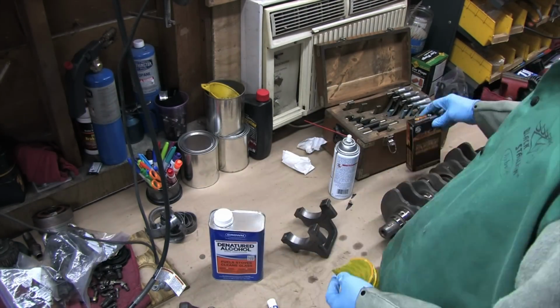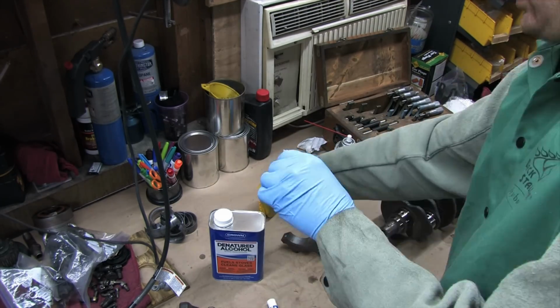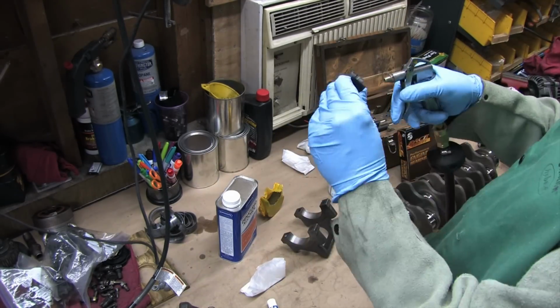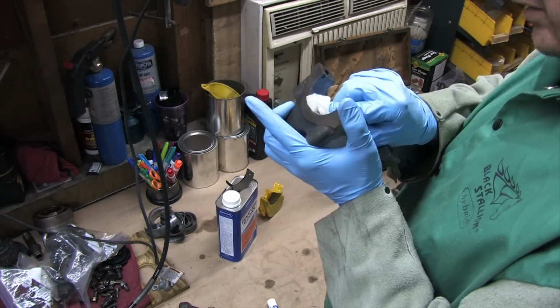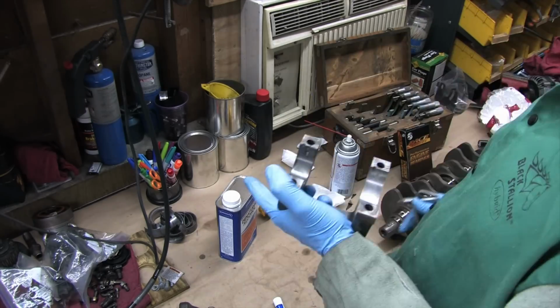I bought standard 6-bolt ACL H series bearings, a considerable upgrade for this engine. There's 2 sets of bearings in this box. One is wrapped in yellow to alert you that they're different than the others. The yellow pack goes in the main caps. The other pack goes in the block. The reason behind this is based on the thrust loads and the oil holes.